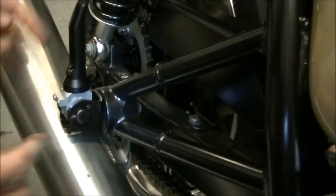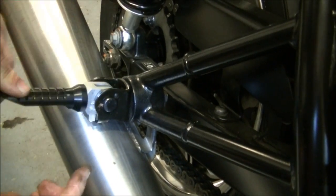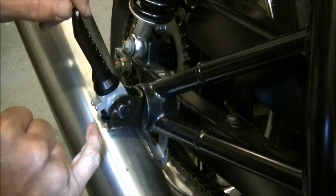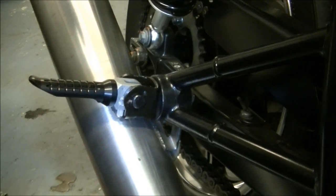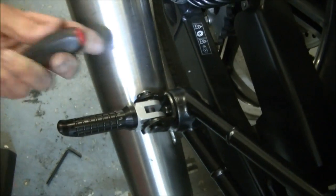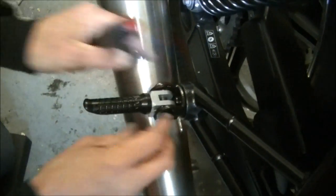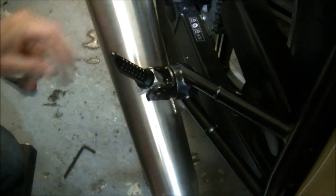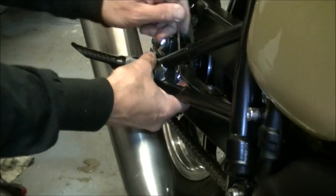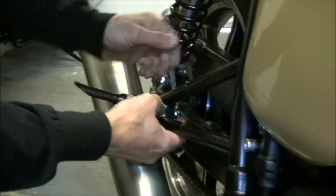Now before you put the clip in, just make sure it's operating correctly — you can see as it comes up it pops into that hole. Nice. So we just need the last little job: put the clip in place that way around, and again use the rubber handle of a screwdriver to grab the back and just snap it on without any damage. Push that back into its little seat and tighten it back up to its correct 18 newton meters — although you won't get a socket on the back to measure that, so just do it by feel.